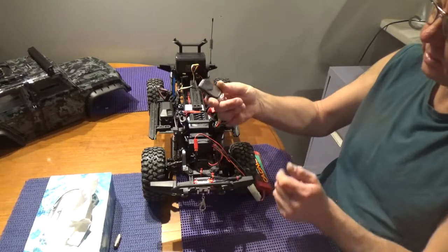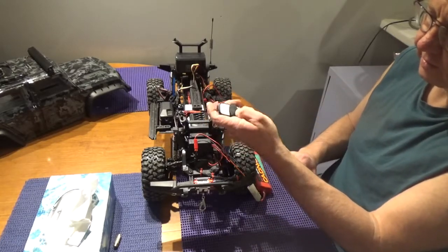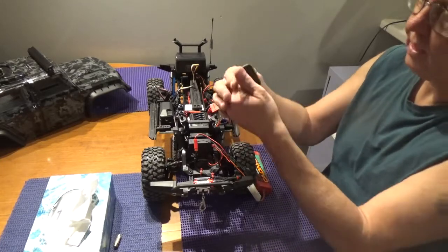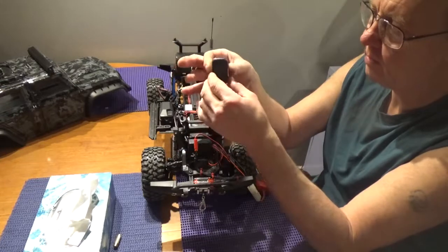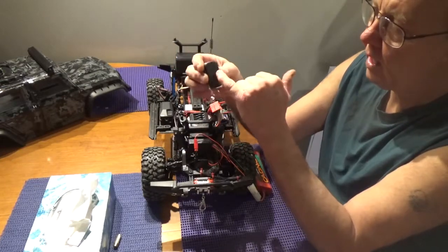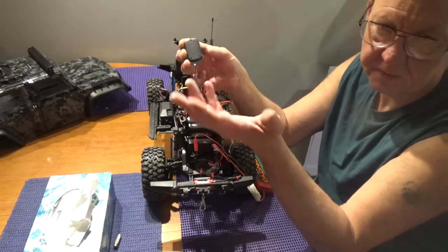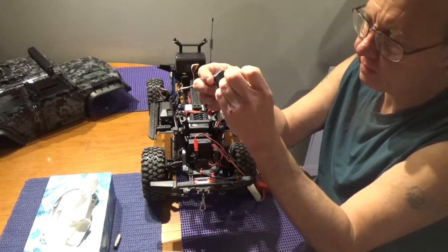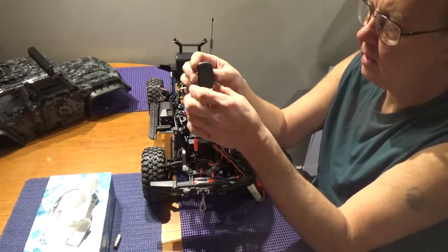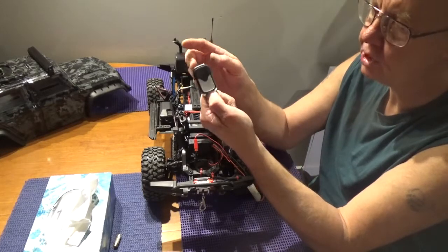To avoid accidentally hitting the buttons, it has a little slip cover that slides up and down. There are three screws that hold the back cover on, and the whole thing comes apart in different pieces. Be very careful with it though — if you snap your PCB inside you're screwed. Be very careful removing that battery and putting the new one in. Pretty easy to change overall.